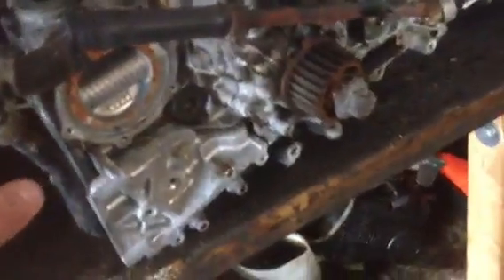I'm building a motor up for it. I have a short block out of an 03 Forester that was good — the heads were shot, so we already used the heads on another car and got it rebuilt. I'm going to be cleaning up this motor completely, repainting it, and throwing it in the car. I got a new timing belt, water pump, all the pulleys, all that. New head gaskets are coming, I'm going to re-lap the heads on that motor, make sure everything's good to go, bolt those heads on, and bolt this motor in the car. I got to buy an oil pan because the guy took it off and I don't know why.